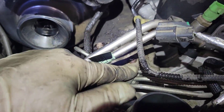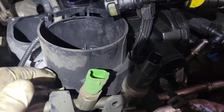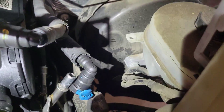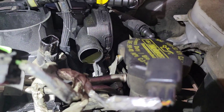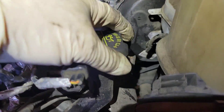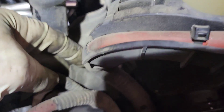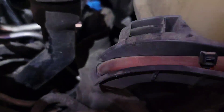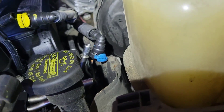To get this supply tube out, you have to disconnect a bolt here, bolts on this side, some sensors, and some different connectors. You're also going to be taking out the oil fill cap — one bolt there. You need to take out these sound insulators on both sides. There are five on each side and most of the time they break.